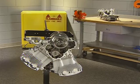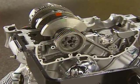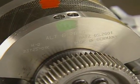Anytime the cases are separated, you must replace the main bearing inserts. This can be done without disassembling the top end or removing the crankshaft. Refer to the service manual for current specifications. To determine what size bearings will be needed, look for the size codes on the crankshaft counterweight on the clutch side. ALT refers to the alternator side.